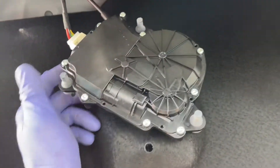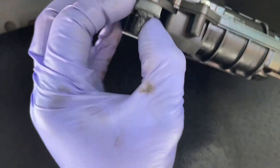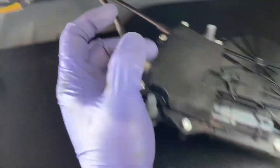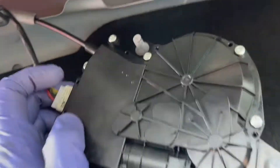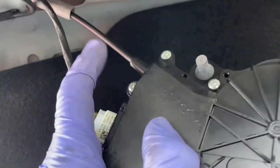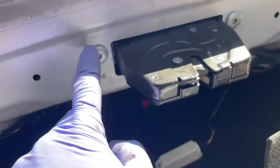After a little time, we're able to get this actuator out. You pretty much use a flathead and just push these little flared-out parts of the grommet inward and push it up so it goes through the holes — all three of them. Go ahead and unplug it right there. We're also going to remove the actual cable itself from the latch, so we're going to follow it. You can see it goes all the way through and back around. With the T30, let's remove this to expose it so we can get to the cable.